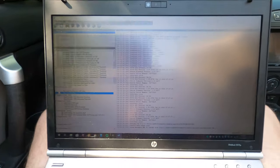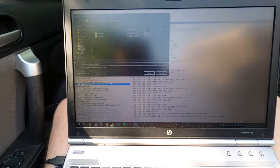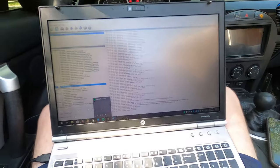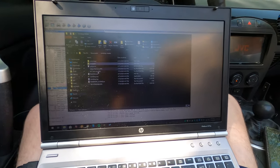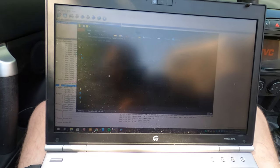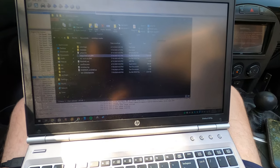I'm now going to save this ROM as baby's first tune. Now turn the car back on. Okay. And I can go into my ROM drop folder. I'm gonna take babiesfirsttune.bin and drop it right onto romdrop.exe, and it will open up and then close. What just happened?